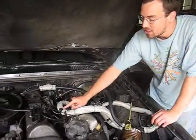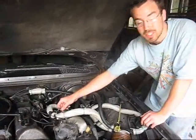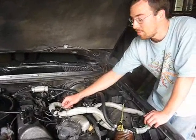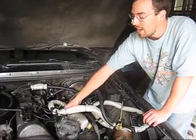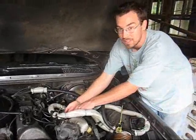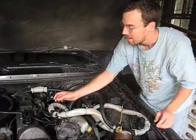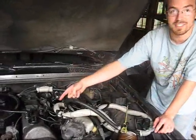When it gets to the switch here, this goes to a switch on my dashboard. So when I'm driving along and everything gets up to the right temperature, all I have to do is flick the switch and it converts from going on the diesel — or the biodiesel in this case — to the waste vegetable oil, and then it goes into the engine and combusts.